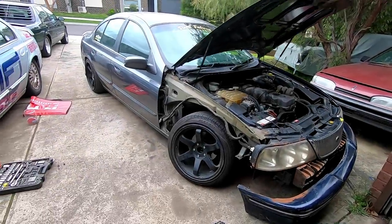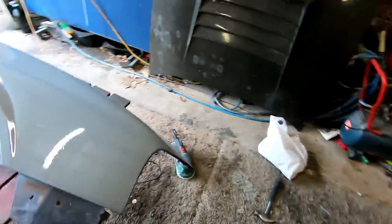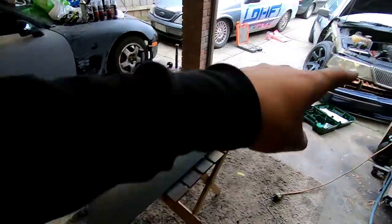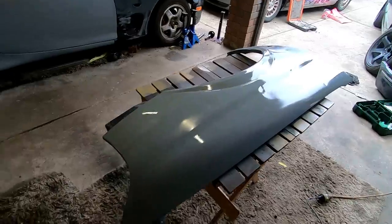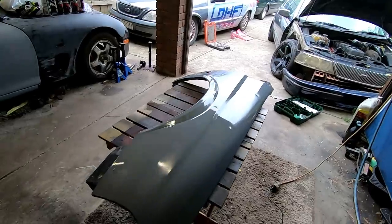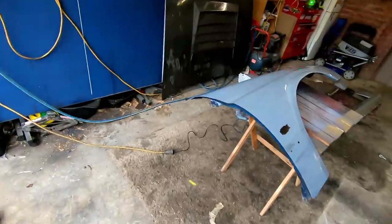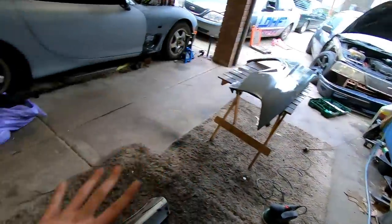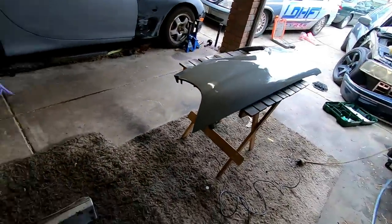So I pulled the guard off this side as well as the side skirt. I've just whacked some epoxy primer on it — it's not fully covered. I wasn't going to prime these guards, I was going to paint straight over them, but because it's a darker colour — we're trying to cover a blue with a silver — I thought it'd be better to epoxy it. At least it's got a sealer coat and then we can paint the silver metallic over the top. A lot of you probably don't know but I used to be in the paint and panel industry for about two and a half years, so I picked up a lot of skills through that. So let's hope this rattle can job comes out half decent, otherwise I'll look like a fool.